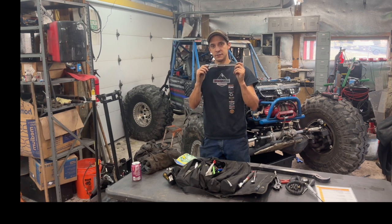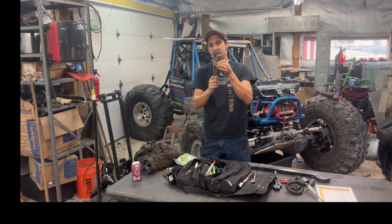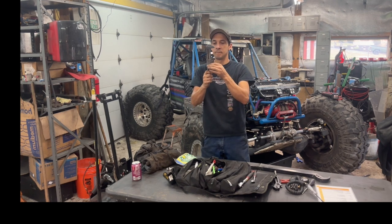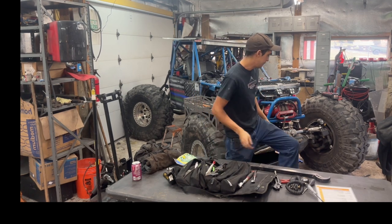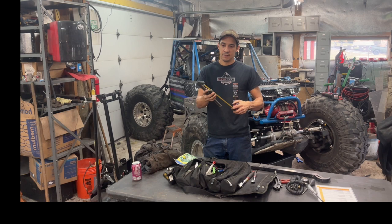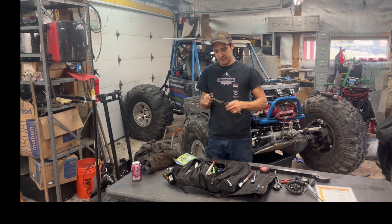This is one of my favorite tools and I preach to everybody — you should buy one. This one is super old, I've bent it and re-straightened it. It's called an auto wrench by Crescent, or a mechanics wrench. When you need to tighten the link bolt or link jam nuts, this is what you reach for. The overall length is just eleven inches and the opening width is almost three inches. Tools that are tight and compact but can do multiple functions.